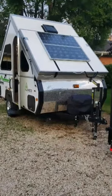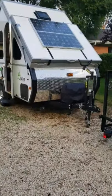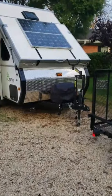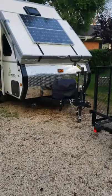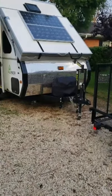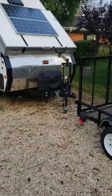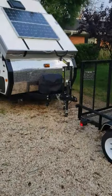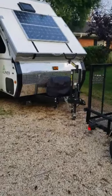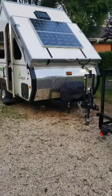When I run the air conditioner on the generator with shore power plugged in, one night the generator ran out of fuel and turned off. We didn't wake up — it was fine because the propane was still on from cooking dinner. The refrigerator had automatically switched over to propane when it detected loss of 115-volt power from the generator. I don't yet know whether it will automatically detect if the propane is turned off and switch from 115 volt to 12-volt automatically — that's another test we're going to run.